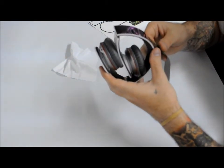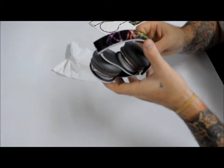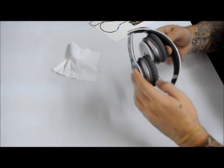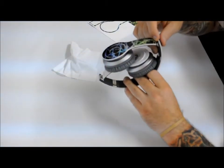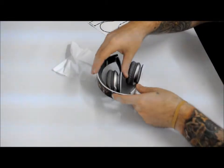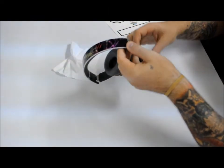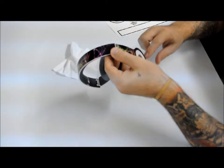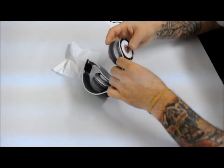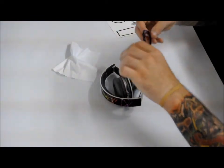This piece is very critical — you don't want to pull or stretch the vinyl. These are measured pretty close to exact, so if you pull it and it does stretch a little bit, it will not match up at the bottom. So you want to try and be gentle. Just slowly going around the edges. I try to make sure I get this part lined up and that it's going to fit before I start pushing anything on, just because these sides are so skinny — if you have to pull them back up they can stretch and it just becomes a pain. The more planning and precise you can be with this, the better.